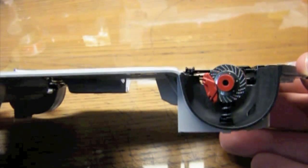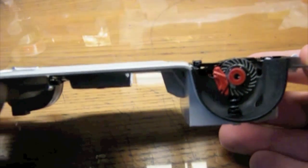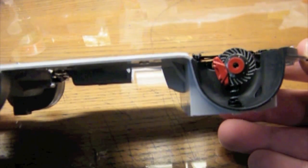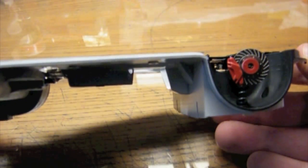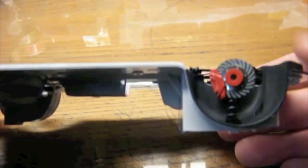What you've got to do with this, and these came in the trans kit, they're set up with the 4 brakes done separately. They're directional, and then they're cut for the individual calipers. The fronts here are a little bit larger than the rears. And you just drop the brake disc in place, and then you drop the center hub over those.